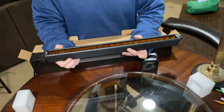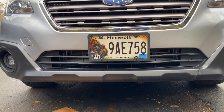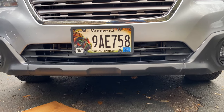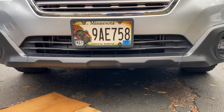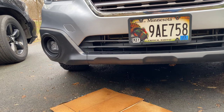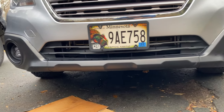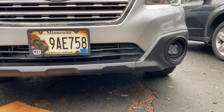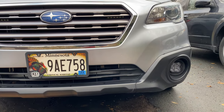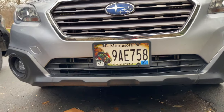I'm going to be mounting the new light bar down in this section right here. To do that I have to take off the front bumper, which means removing six or seven tabs under the hood, several underneath the bumper, and one on each side inside the wheel well. Once those tabs are undone you gently pull on the bumper, it pops off, and then you can disconnect the fog lights and fully remove the bumper.